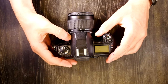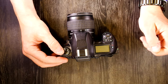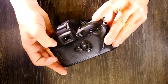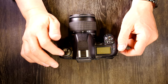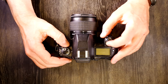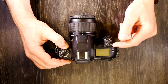We have the flash hot shoe, the pop-up flash, the LCD screen, and the film plane indicator — a little raised area next to the LCD screen. The LCD screen illuminator button, combined with the flash button, allows you to rewind your film partway through a roll. There is also an EV compensation button next to the green dot, and next to that is the flash compensation button.